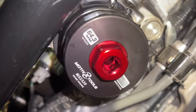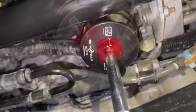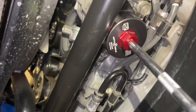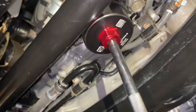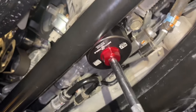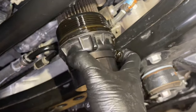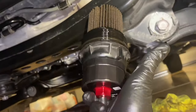You just put your ratchet up into the top of it with an extension. I did have to use a breaker bar — whoever did the last oil change put the filter on very tight, but it did break loose. There is a little catch that's supposed to keep the oil filter from coming off on its own, so just make sure as you're removing this that the catch isn't stopping the filter. You don't want to break that. We're going to go ahead and remove the entire oil filter housing. The entire housing will come down with the filter still attached, and as you can see, it did not make a very big mess because we pre-drained it, which was really nice.